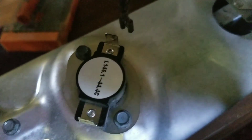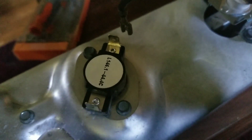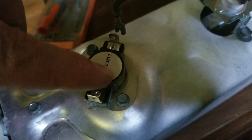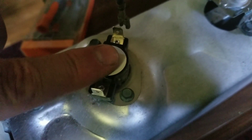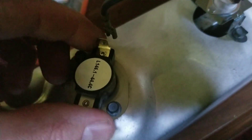The basic principle is: if this thing gets way too hot due to lint or some other factor, it will overheat. The inside of this has two different kinds of metals that oppose each other. The high heat will affect one of the metals more than the other — it'll pop off the contacts, breaking the continuity of the electricity and turning off your heating element.